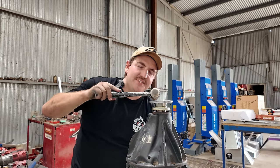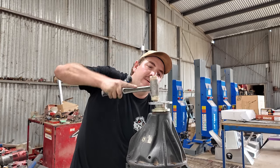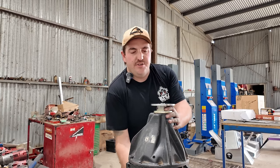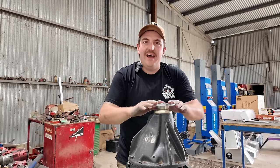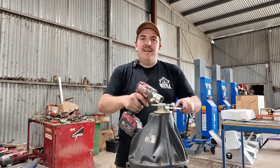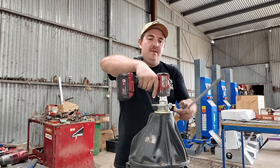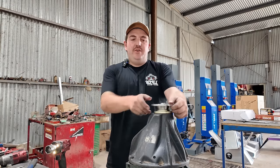You can do this two ways - you can use a press or you can use a hammer. For the purpose of this video, I'm going to use a nylon face hammer to bash this on. The last one I did, I used a real hammer and it dented it all up - it's nice and new, it looks good, I don't want that. What you just watched there is me pressing the bearing on with a nylon hammer. Now I need to put this in here - I want to go bit by bit because I don't know if it's going to be over-tight with no shims or just right. That is tight. That feels really, really good.